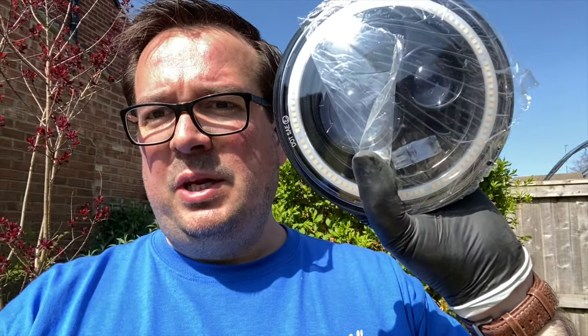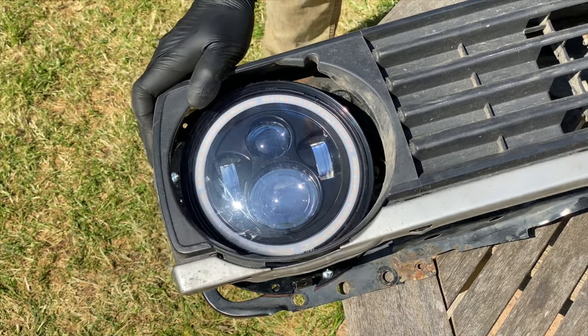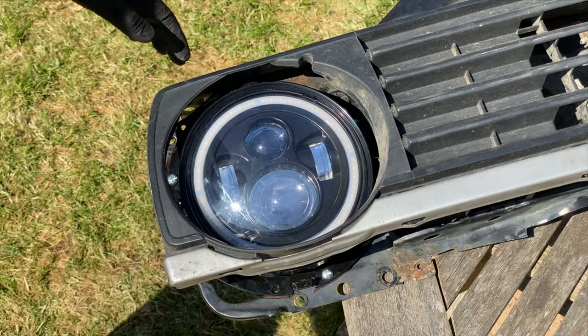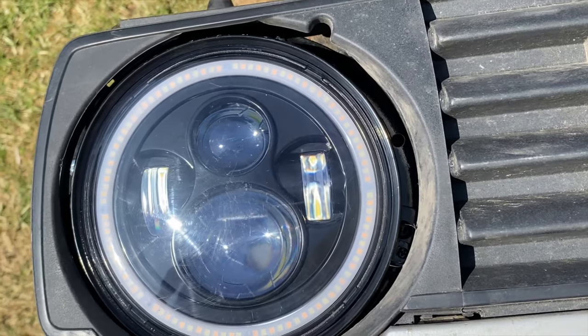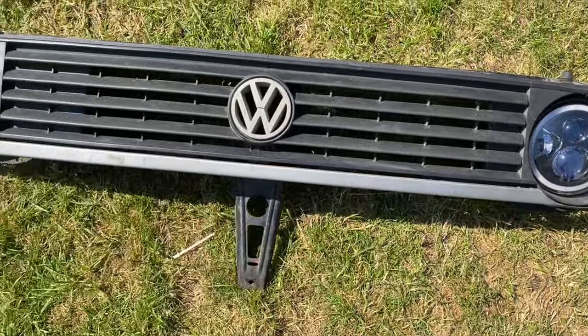Now we've got the light mount fitted to the front panel, it should just be a case of unbolting it, popping the headlight in, and making sure it all lines up nicely. When fitting the headlight you'll see there's a little E-mark - that actually goes upside down at the bottom of the light. You'd think it would be at the top and look pretty, but these are cheap eBay lights so make sure it's at the bottom when you fit them. With that mounted in the ring, put the grille back on to make sure it fits nicely. After repeating the process on the other side, that is a pair of seven inch Jeep headlights fitted into a Mark II Golf front panel. A little bit of last-minute adjustment and it's absolutely spot on.